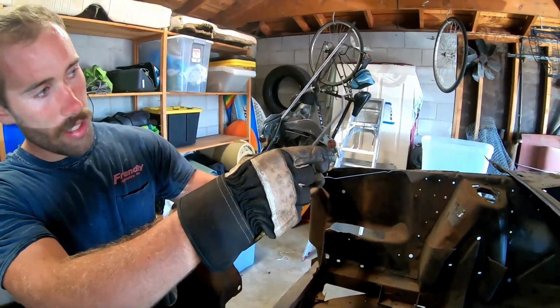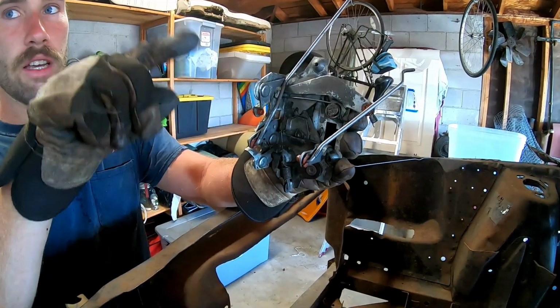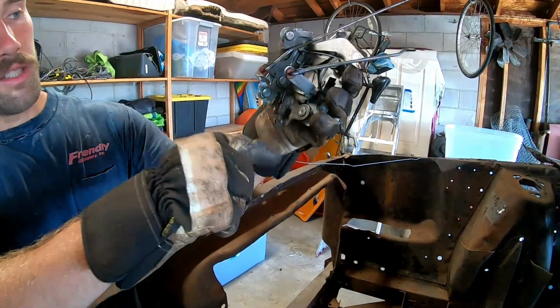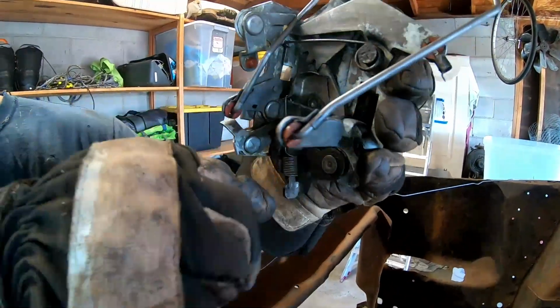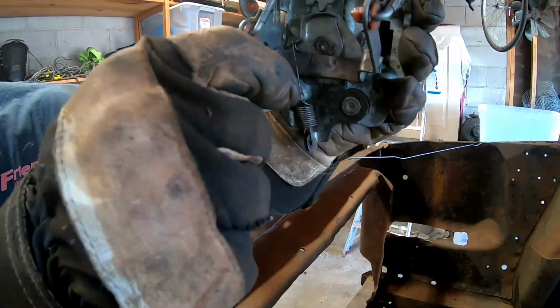So what you want to do is, if the door button isn't working, when you try to push in, it's not disengaging this. It's because this mechanism right here isn't being pushed down far enough. So when you push that little rod down, you have to get in contact with maybe the edge right here, and you push this down, and it unlocks it.